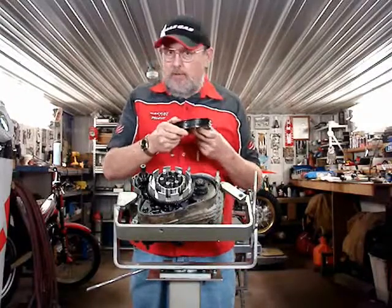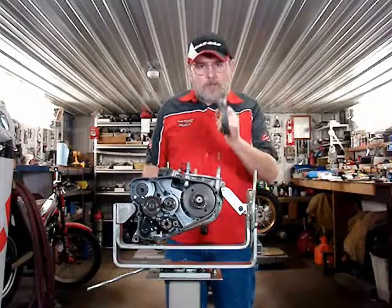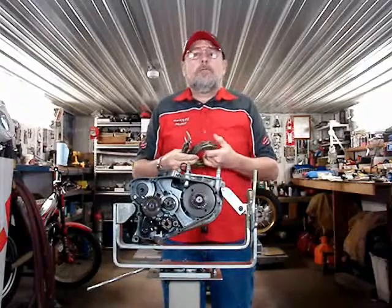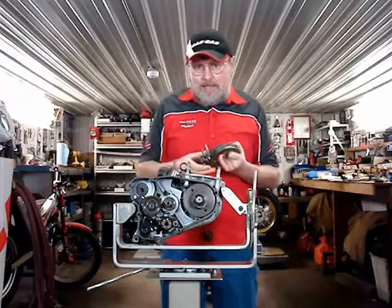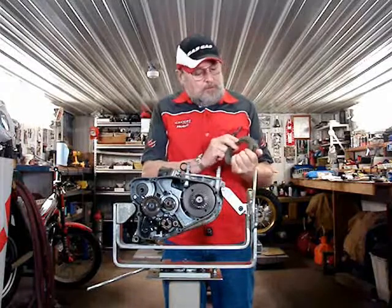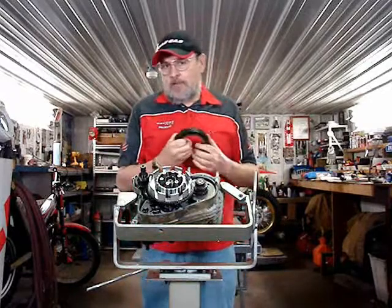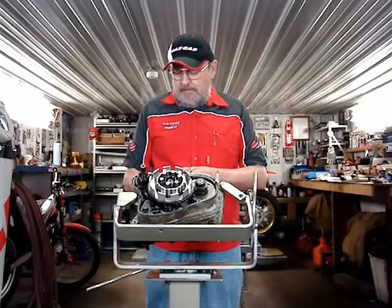you will inspect your clutch. And then we also have the clutch dimensions for the whole clutch pack width. When you're checking to see if your clutch plate set is correct, you want to grip it tightly and measure it with your caliper. And 26.3, 26.5, 26.9 millimeters in that range. You may find that when you take a used one out to measure it, it may measure a little more, 26.9 or something. And that's because the oil saturates the fiber discs and causes them to expand slightly. This clutch I'm holding in my hand is a new one, so it measures 26.35 millimeters.